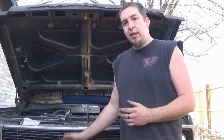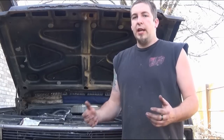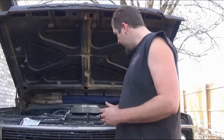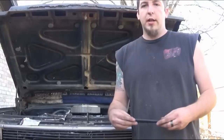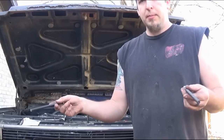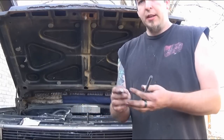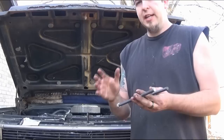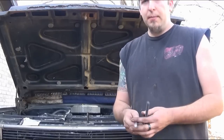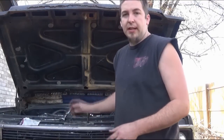Other than the normal parts of pulling the transmission out of the way, there's a little trick I'm going to show you guys. Especially if you're shade-tree-ing it like me, laying on your back moving the transmission — lining it back up can be kind of tricky. So I got some all-thread right here, cut to length with nuts on the back side. Pull the two bottom bolts out, put the all-thread in, and when you slide the transmission back it stays in line. Once everything's replaced and you push the transmission back to the motor, it'll already be lined up.